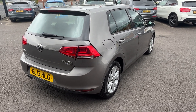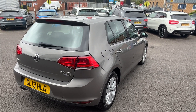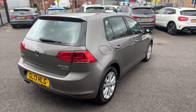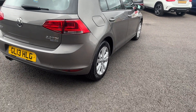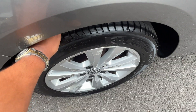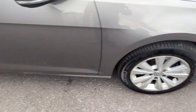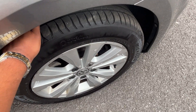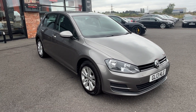Offside rear bumper corner to refinish in the paint shop. Rear quarter is good. Offside rear door good. Offside front door good. And the wing is good. Sill has a crease in it, so refinish in the paint shop — the sill where the driver's door has a crease. Michelin tyre again, six or seven mil, almost feels brand new. Touch up the door edge when it goes into the paint shop. A little bit of damage on the sill there — just to refinish in the paint shop. Another Michelin tyre running a good five mils of tread at least. Nothing else down that offside.